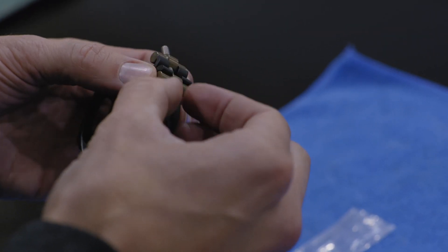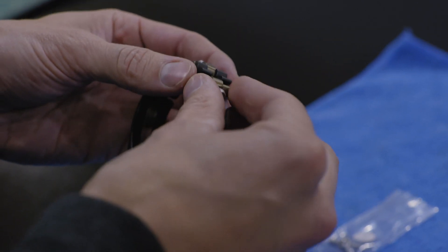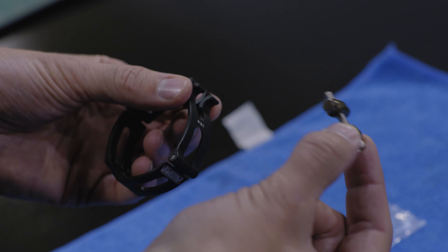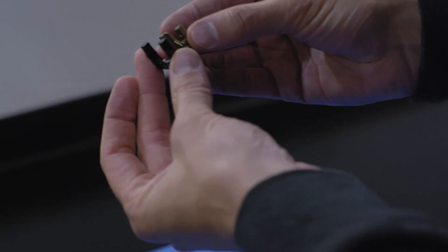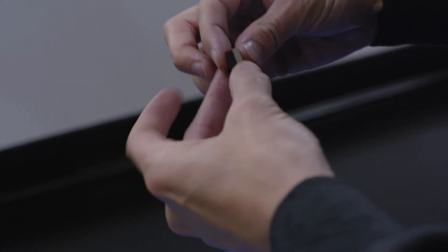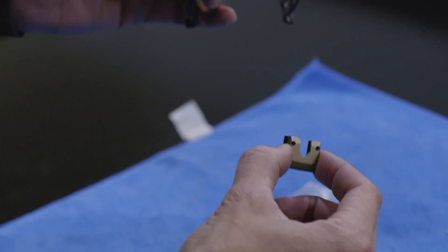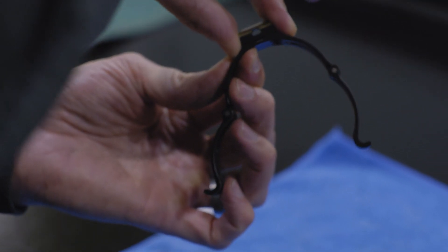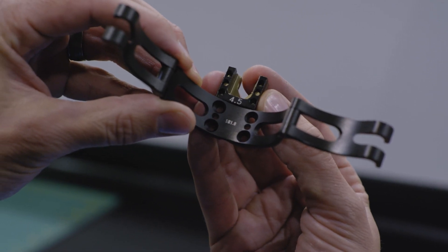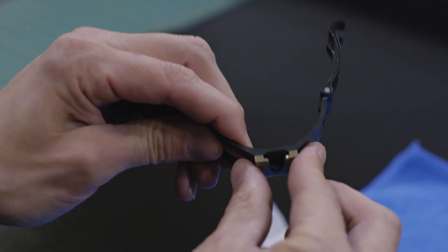We'll start our CRF450R fork ring assembly by first removing the fastening system on the backside of the ring. You don't need to fully remove the bolt here — just loosening it will be enough. Next, we'll mate the receiver to the spacer. Note that the notched sides should face one another. Together, these notches form a drainage hole. After this, mate the receiver-spacer combination to the ring. Note the orientation of the receiver to the ring. The open ramped end of the ring corresponds to the open V-grooved end of the receiver. A good way to check that these pieces are correctly oriented is to make sure that the markings on the back sides are all upright. If your application does not use a spacer, this step would proceed in much the same way.